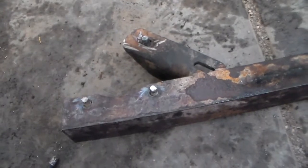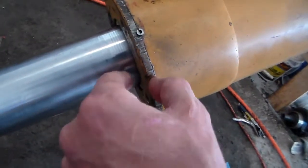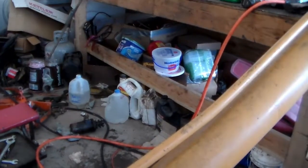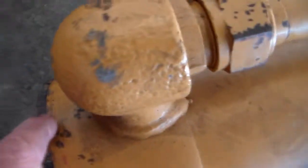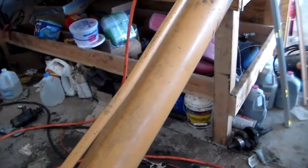My spanner wrench that I'd built months ago — I just had to straighten the pins, they bent a couple of times. I stuck it into three of the holes, then took a couple pairs of vise grips and clamped them to the edge of the gland so I could manhandle it without it popping out of the holes. Threaded it in and got it seated. Then I snugged it a little tighter with my air chisel on a point bit, using one of the holes that was already buggered up. Got an eighth to a sixteenth of a turn tighter, then pinned it in.